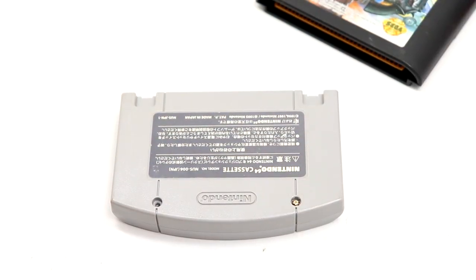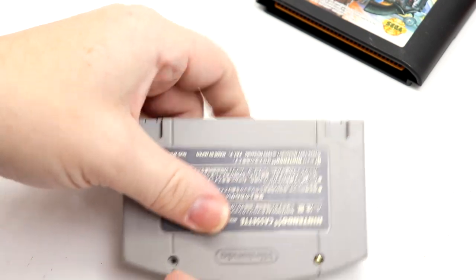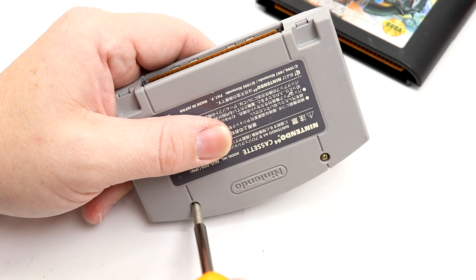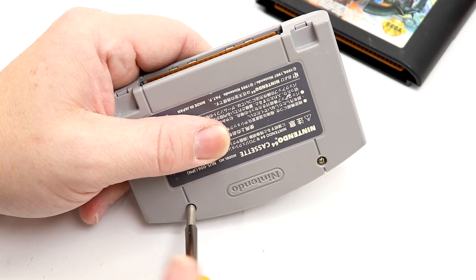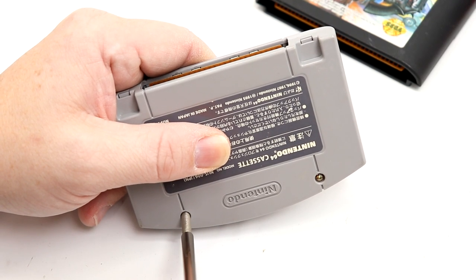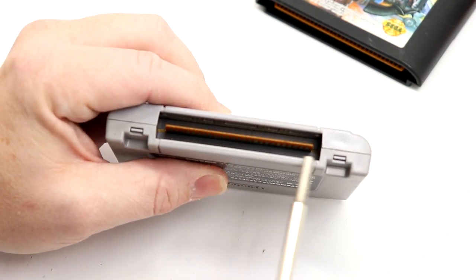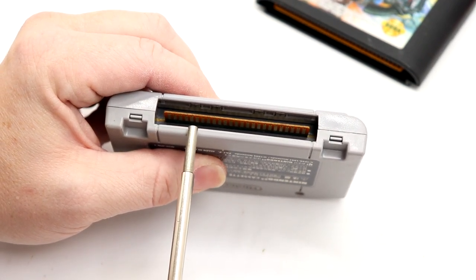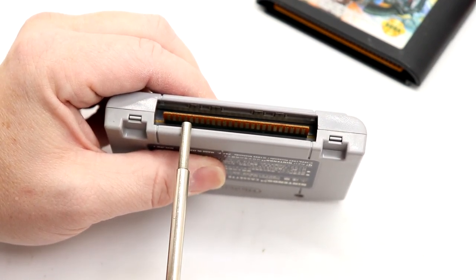So nice to see that I didn't have to break out Bright Boy. And what Bright Boy is, I'll show you that in a second. For many years in the retro gaming community, they used Brasso, a brass polisher, to clean really, really dirty cartridges. And the problem with Brasso is it removes a lot of material from the pins themselves. Think of it like, and John Riggs has got a great analogy here, think of it like resurfacing a CD or a DVD or something like that.